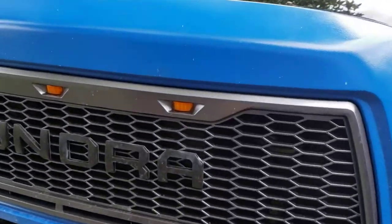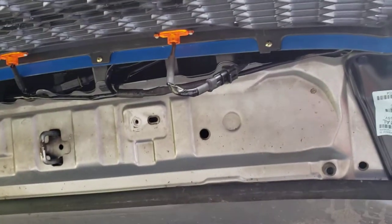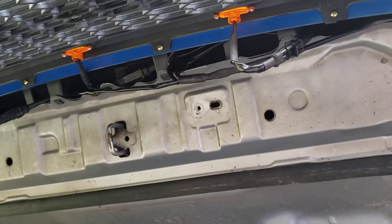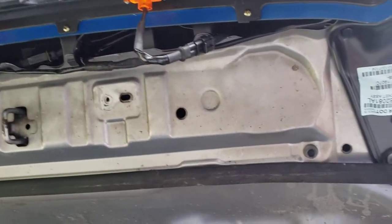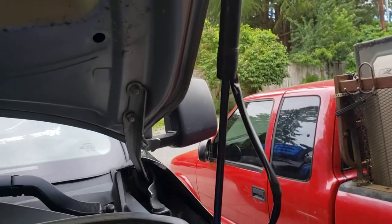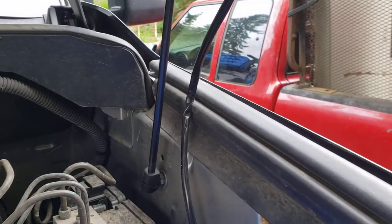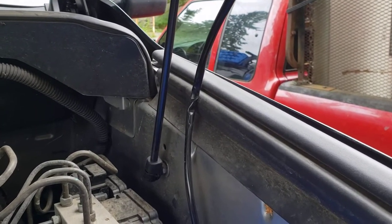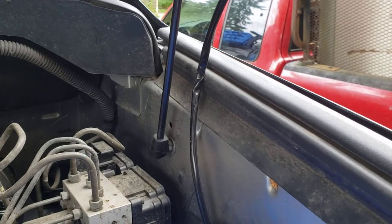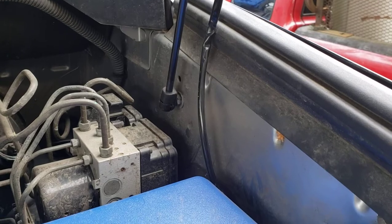So this is the way I did it. I hooked up the three lights, the three brackets, to the main cable, ran it around the hood, and brought it down on the strut over here. This cable comes with two wires inside that housing — a black wire for the ground and a red wire for the positive, which is your power for the lights.